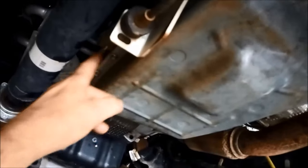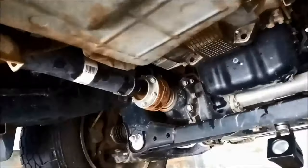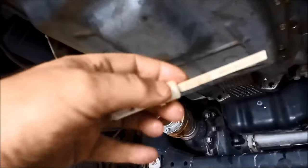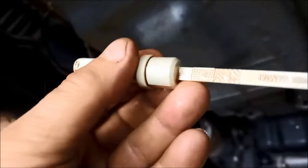Okay, we've got the pan back on. Now with these, because they've got that thermal cooler valve, the proper way to test them is to get the thermal cooler valve open so you know you've got no air in the cooling circuit or hydraulic circuit. When you put one of these bypass valves in, you can actually check the oil level between 30 and 50 degrees. The dipstick has a lower mark and a higher mark, A and B - at 30 to 50 degrees you want it in between the A mark. If you want to warm it right up to operating temperature, about 80 degrees, you've got to get it up to the B mark. The problem is where you're checking it is right in there and you've got this hot exhaust right there - that's why these thermal bypass valves are a really good idea.